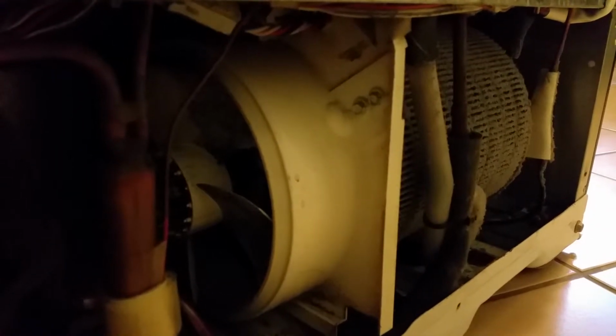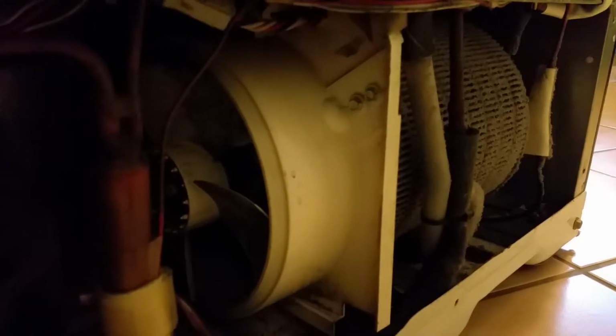So these are my quick tips for you guys to check. Why is your refrigerator water not coming out? The first time, it was the freezer, because the line comes out from the freezer and it got frozen. So I used my hair dryer to blow out and melt the ice on the water line. That's how I fixed it last time.